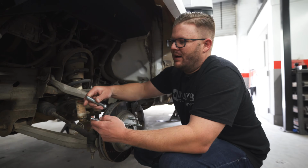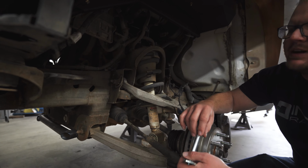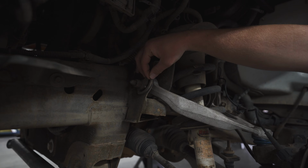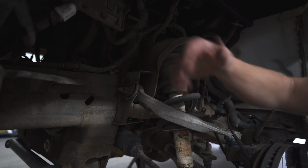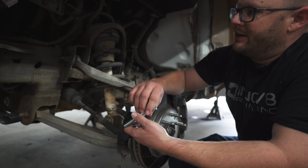I'm gonna give you a lowdown on how to simply install these in your home driveway. Easiest thing to do is take your truck to your nearest alignment shop and get it fully aligned. You'll see that this factory bolt has a flat edge to it, and your stock cam has a flat edge to it, which allows it to swivel on this bolt to set your alignment. You'll see on ours it's just standard hardware with a round circle, so you can't swivel it obviously.